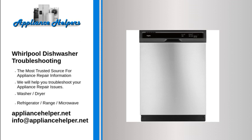If your dishes are coming out still wet, make sure you are using a quality rinse agent. Whirlpool Gold dishwashers rely on a rinse agent such as Jet Dry to aid in the proper drying of dishes. Also make sure the overfill protection float can move up and down freely; if it is locked, press down on it to release it.